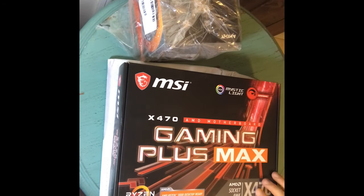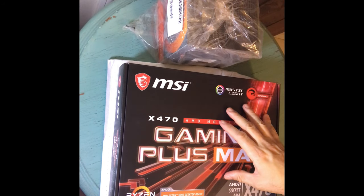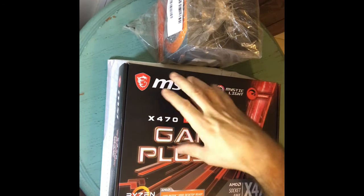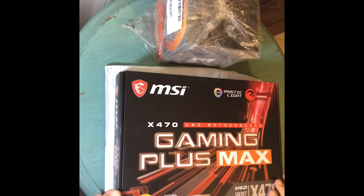This is a desktop-ready Ryzen 9 3900x. My big thing when I had the Asus board — things weren't posting, the display indicated it wasn't booting. As I go through the compatibility matrix, there's a site out there — I'll post that, I think it's called Build Parts or something like that — that helped a lot. Make sure you have the right memory; you can check the serial numbers on the memory to confirm you have the right parts.